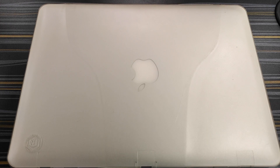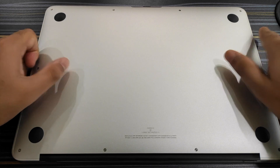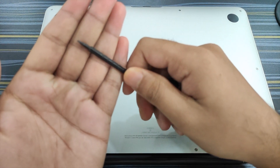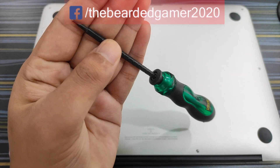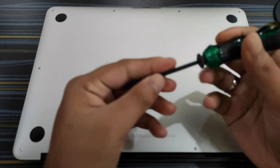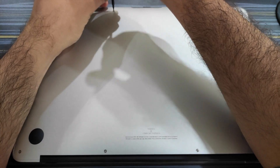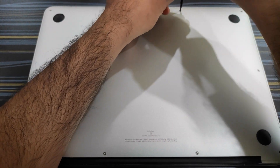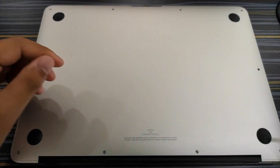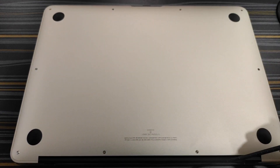Now let's close this and move on to the actual physical upgrade. We'll place the MacBook on a stable desk surface and turn it around. There are 10 pentalobe screws holding the back panel together. To unscrew them you'll need a pentalobe P5 screwdriver — I've added a link to the toolkit in the description. I'll fast-forward this section to save time. The two screws at the bottom of the MacBook Air are the long screws, so keep them separately to avoid confusion.